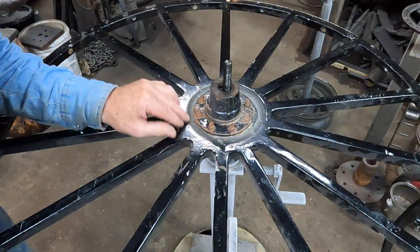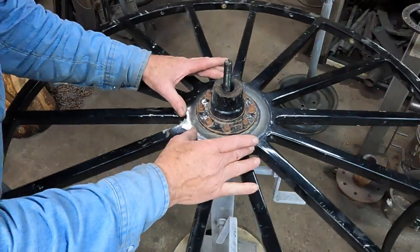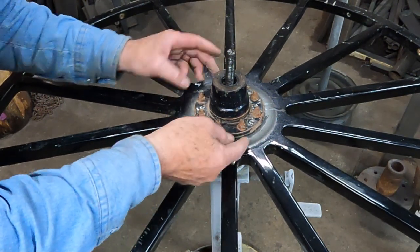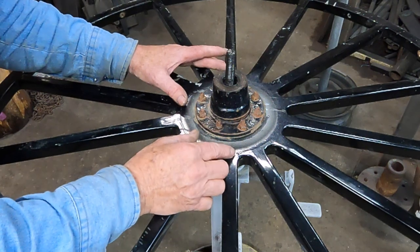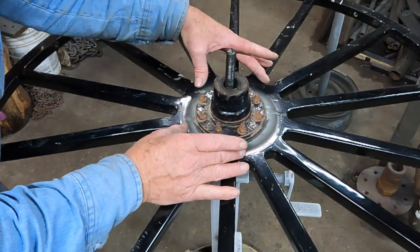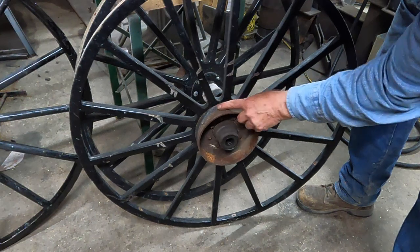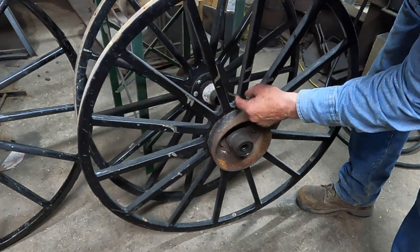The center around the hub is fairly broad because these are designed, if wanted, to accommodate a brake drum for hydraulic brakes. On an old wooden wheel the spokes would come right into the edge of the flange on the hub, but these are extended quite a bit out — I think to increase the strength of the hub plus to accommodate brake drums for hydraulic brakes. Out of the four wheels I have here, two of them have these hydraulic brake drums attached, and you can see how they come out to the outside perimeter of where the spokes come together.